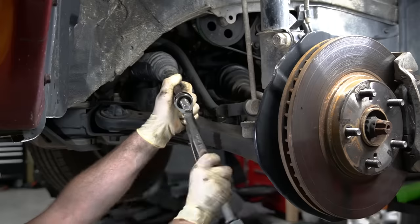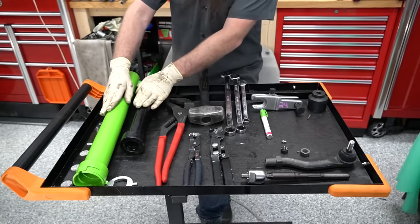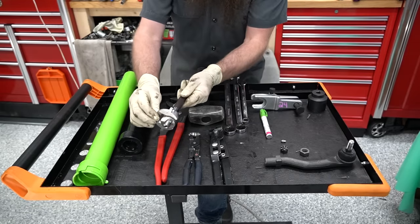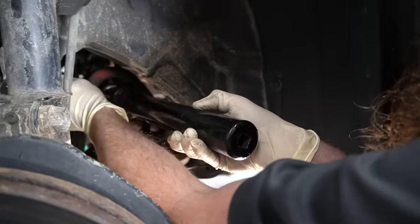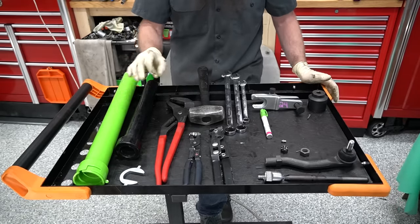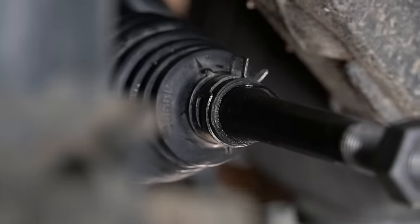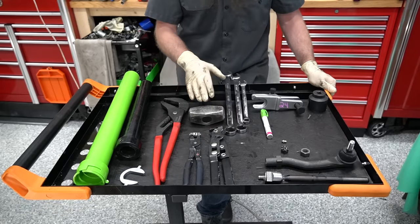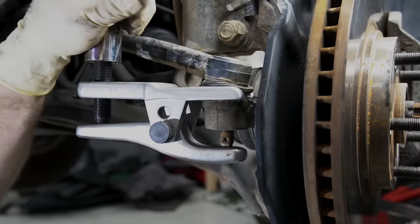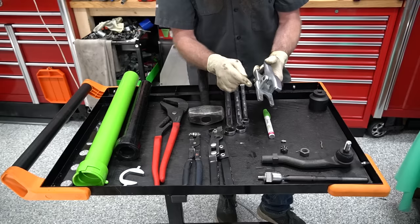When it comes to the tools required to do this job, oftentimes you can do it with really simple basic hand tools. However, there are a couple of specialty tools that make the job easier. These two here are to remove the inner tie rod — this big green one has assorted adapters that hook right on the inner tie rod to loosen and tighten it. This black one basically does the same thing, except you tighten a little allen. Sometimes these work, sometimes they don't — it really depends on the size of the inner tie rod. If you can gain access, usually you can get a pair of big pliers on it. Our bellows boots will have some kind of clamp, either a spring clamp or maybe a crimp clamp like this one, or even a worm clamp. For the outer tie rod, you may need a tie rod separator or a ball joint press to pop it free from the housing — a tool I wish I would have bought earlier in my career because it saves a lot of trouble and you don't have to worry about damaging the knuckle.